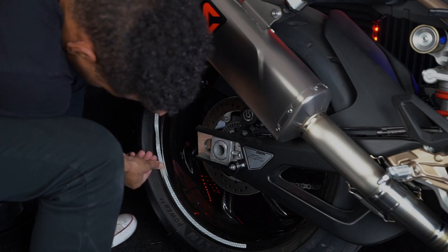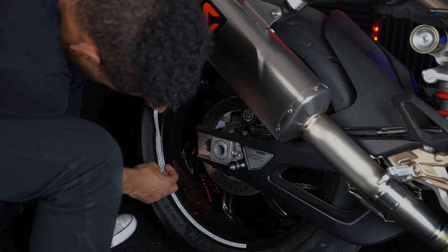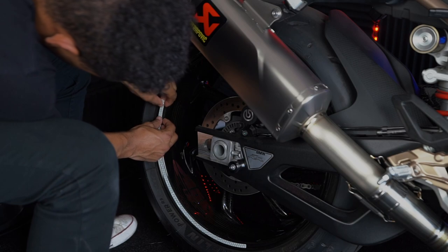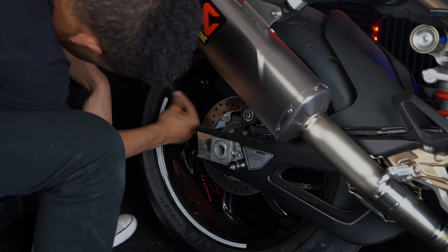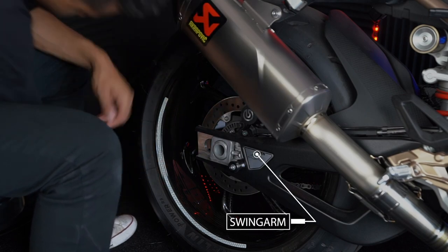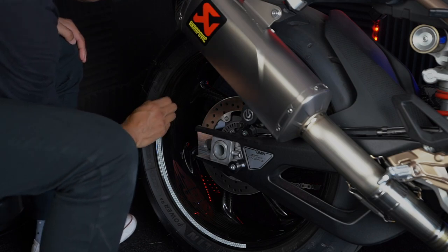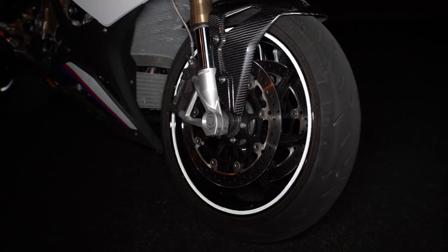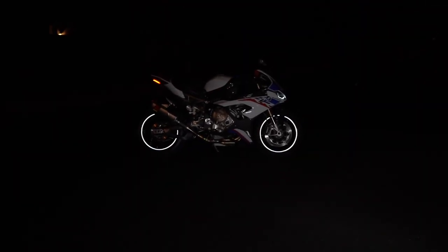Make sure that you are following the curvature of the wheel so the tape isn't going in some crooked or weird way — you want to go around the wheel in a full circle. If you don't have any stands to prop up the wheels of your motorcycle, it's no big deal. Just roll the motorcycle back and forth to expose the areas covered by the swing arm. That's what makes this such a simple install — you don't need any tools. When you're done, you can see there are no weird curves in the rim tape; it's following the curvature of the wheel perfectly with no gaps.